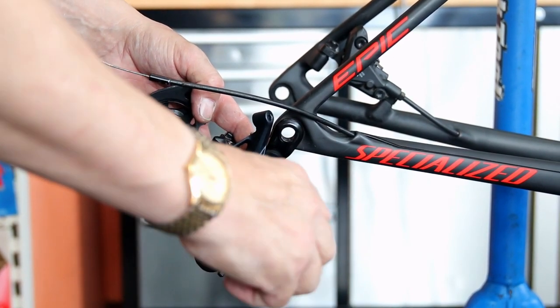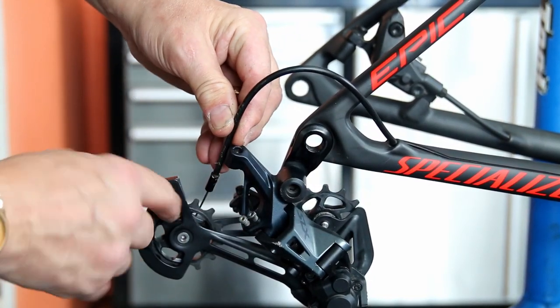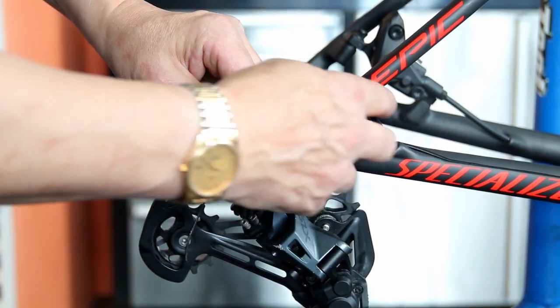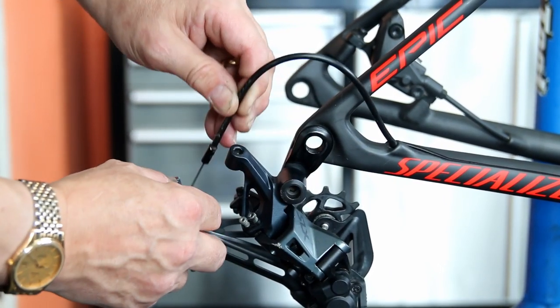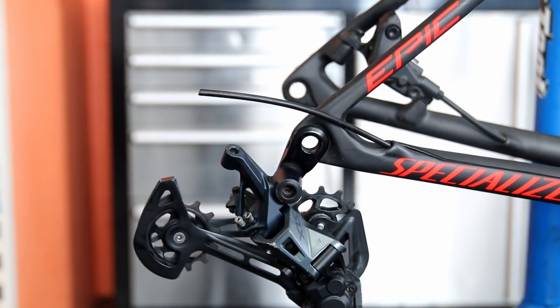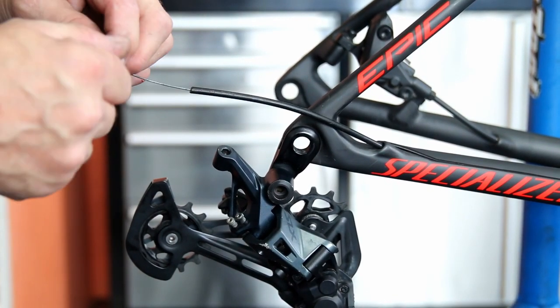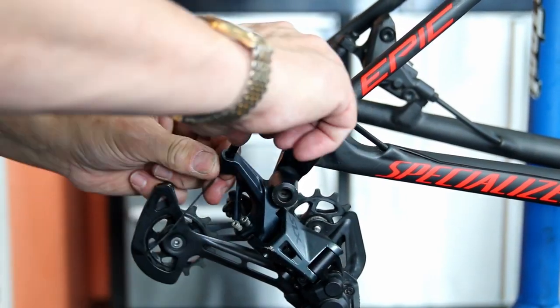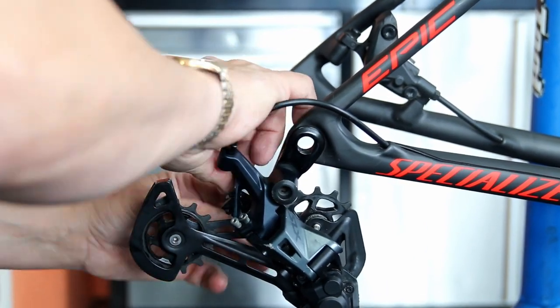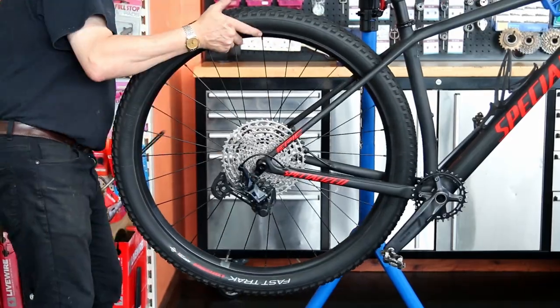Now I'm beginning to put the bike back together. I'm addressing the slightly too-long rear derailleur cable outer — just a couple of inches off, which will make that arc a little smoother and gear changing less taut. Nothing is wrong with the inner cable, so I slid that out at the brake end, nipped off the outer, and reset everything up with a new cable end.